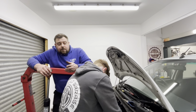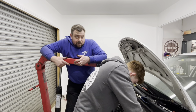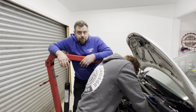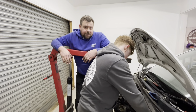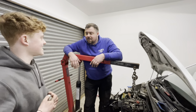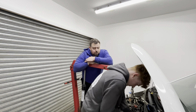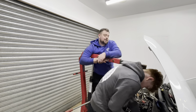When we were taking the radiator out it did look like the radiator's got a tiny leak. There's also signs of K-Seal in here, so I think it's had a bit of water loss before and somebody's put K-Seal in it. We're going to have to really check the head and make sure nothing's blocked, because K-Seal can block galleries and cause pressure build up. This may just be the start of the journey for this engine — there's a chance it could end up needing a second hand engine at some point. I'd rather recondition this one, but if the K-Seal's blocked everything up, we won't have much choice.